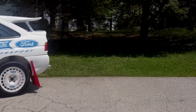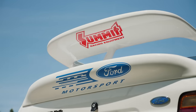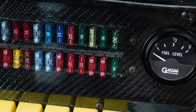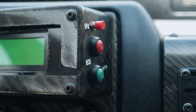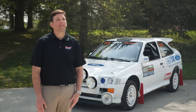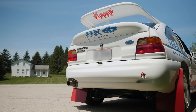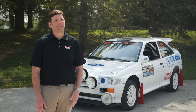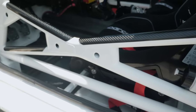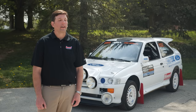The number one unique challenge on this car is sourcing parts that aren't common. Ford has parts designated as 909 parts, which were their rally-specific parts. So daily searches on the internet forums and Facebook for spare parts is always a challenge — parts are getting gobbled up as quick as you can find them. One of the challenges when I got this car was rust, being in the Midwest as well. When this car was built in England, they actually used expanding foam in all the chassis rails and sills for strengthening. A lot of the rust came from the inside out, so that's why I had to get completely rebuilt floors and sills. At that point I decided to update the cage because the roll cage was from 1993 standards — today it's up to modern ARA standards, which is a lot thicker roll bar tubing, a lot more strengthening points, and a lot safer for sure.